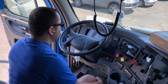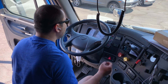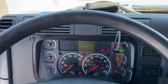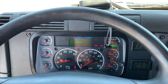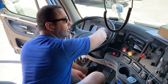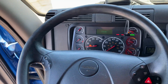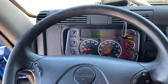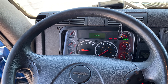First, we're going to go ahead and put the key in the ignition and turn it to the accessory position to see if the light comes on. It's not showing the fault right now — it just says low air, so I need to build the air up. One of the check engine lights is still on. There were two lights that gave us that 25% power reduction issue. I'll give it a second for the air to build up, and then we can see if that code is still in the system.